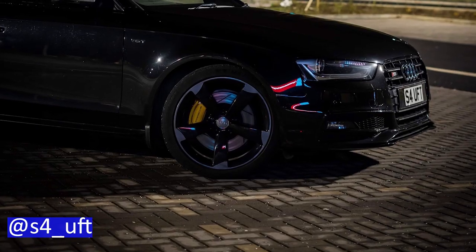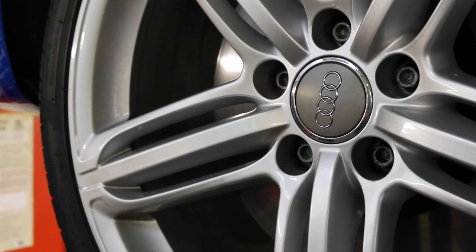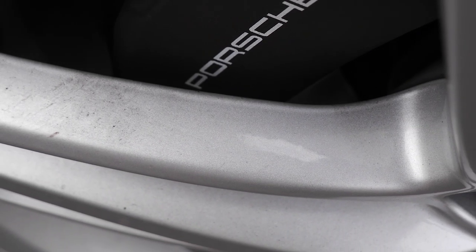I've gone for some DS2500 Ferodo pads which I absolutely rate — they're a little bit pricey at £175–£180, but they certainly give you a lot of bite for your money. You can use original discs; I had new discs on the car already which were straight and true, so I've just reused exactly the same discs, so you physically just change the calipers and the pads. If you need new discs and pads, ideal to change it all. I've seen the Q5 calipers swapping hands for between two and four hundred quid. It runs the same size disc, however you've got a lot more braking friction and a lot more even brake because the pistons are pushing from both sides rather than one piston pushing from one side and pulling the caliper across, which is a lot less efficient.